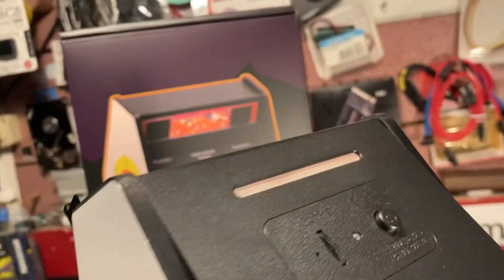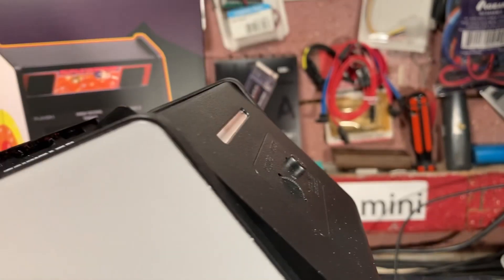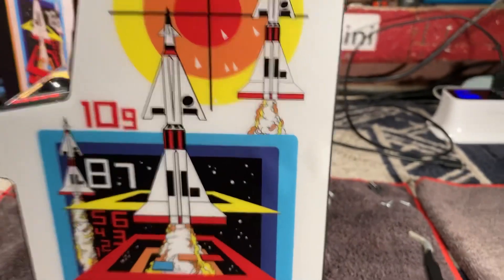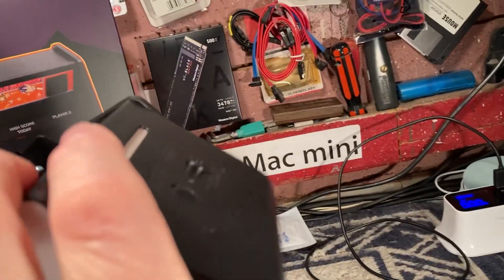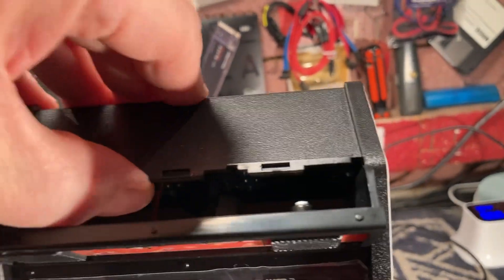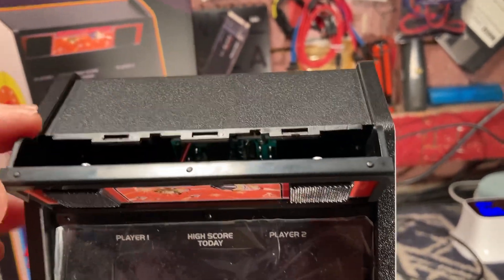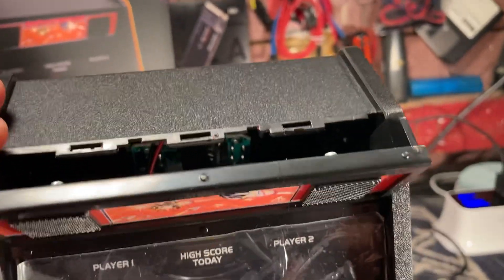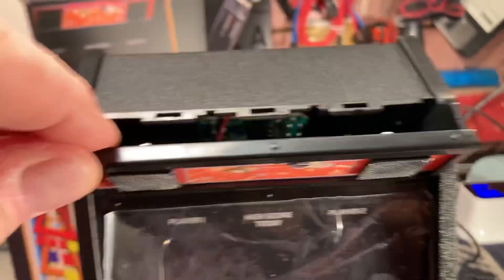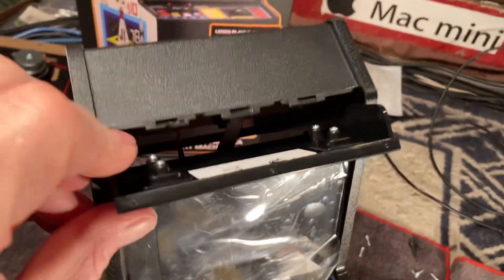The marquee is held together with two screws - one screw right here and the same on the other side. You don't want to damage this beautiful artwork. Allowing it to pivot a little bit will help break this loose because it takes some of the tension off, so it'll be able to move just a little. It doesn't take much, but you will have to exert just a little bit of pressure. Pull here and here - don't pull from the center or you'll put too much pressure there. Once you do that, you can pull that screen forward.